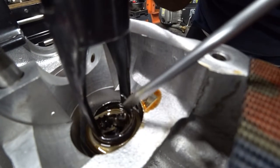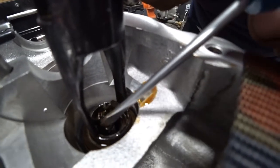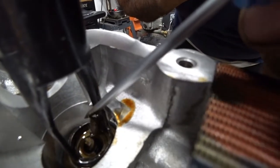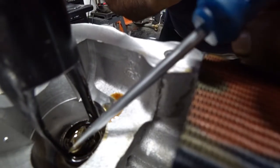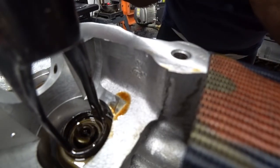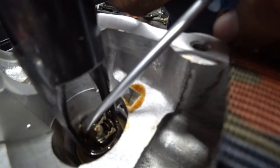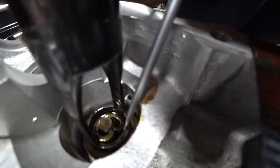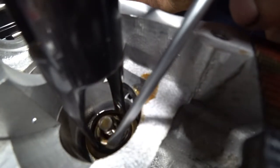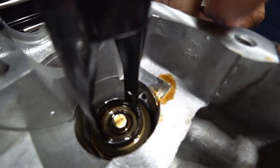You'll see there's a flat side and a tapered side. The small side goes down, the high side goes up. And then you've got to just fandangle it all the way down. And that's it — super tedious. So that's one valve and keeper done. We're going to repeat the process one more time — don't let it hit the aluminum.